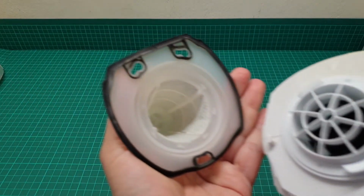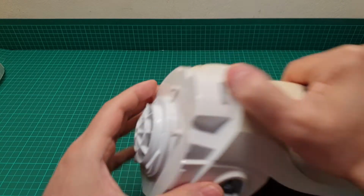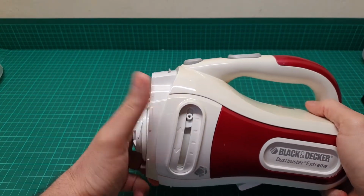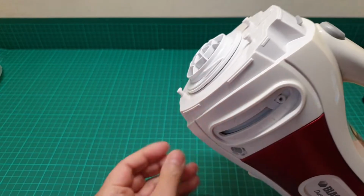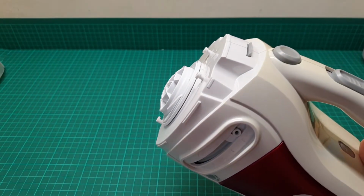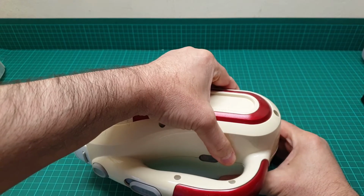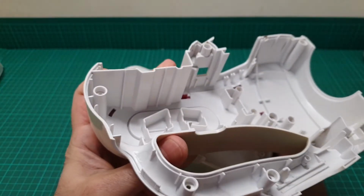You have to take this off in order to be able to part these 2 halves. And I unscrew this one as well, and then I come back. When you unscrew the other screw here, that is for cleaning the filter. It just shakes the filter when it's taking it up and down, and the dust is going to fall from this. And then it's going to breathe a little bit better. As soon as you open this, all the screws are done, you just have to take this apart from wherever you can, and the top is coming off,